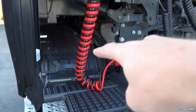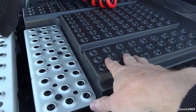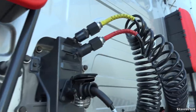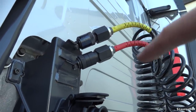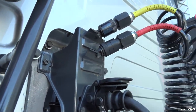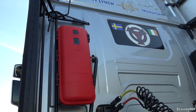And the Anderson cable going into the cab from the batteries — so if ever you're doing maintenance on your batteries you can just unplug this cable and you're completely safe. Great to have for the inverter. And these holders here — John Barrett down in Nolans, a shout out to him — he designed new holders for my Susie, far better job than the ones that Scania give you, and he also fitted the fire extinguisher boxes there as well.